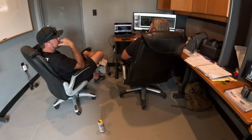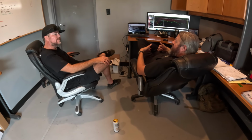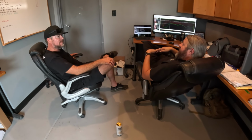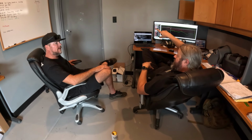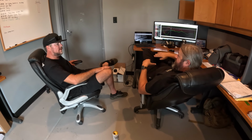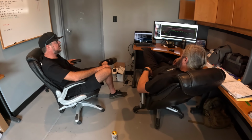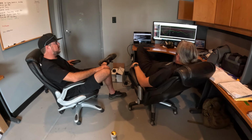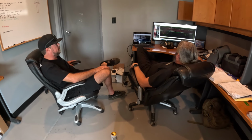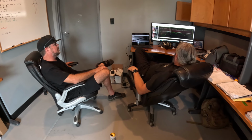Turbo cars will really do it because when you let off the button on the trans brake, say you're leaving at 8 pounds, you let off the button, the motor goes to 55, and the boost will go down until it recovers, because it's taking the air in. Yeah, it's just sucking it in. I've seen these do it a little bit, not like a turbo car, but a little bit.